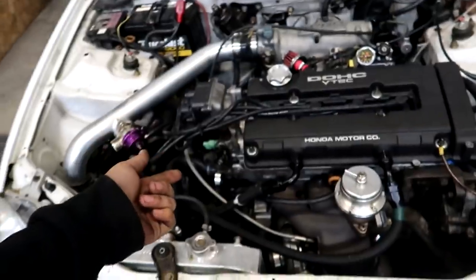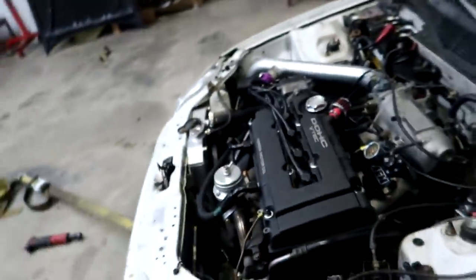The engine makes good oil pressure, but we need to make sure that the head is getting that oil pressure. That's going to be the next step — we've got good pressure at the block, now we need to make sure we're getting it up to the head. It's like it's not fully engaging. Either the pins and the rockers are missing, or the center cam cap O-ring isn't there, or the bottom of the head is plugged off. This head came off of an LS VTEC — this is not the head that this guy was originally running on this bottom end, so this head could have issues.